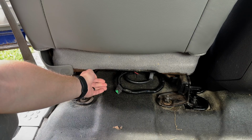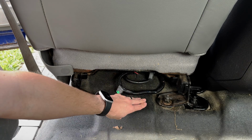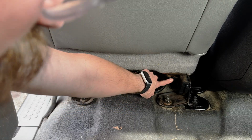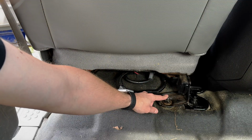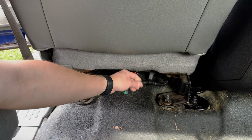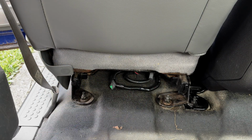So with the wiring all done, we also used some plastic wiring sleeve to protect it. And funnily enough, before we installed this, one of the wires got pinched between the seat mechanism and the stud on the truck and actually shorted out, and it blew the fuse, so everything worked properly. So we ended up having to cut the wire, re-splicing it in, and then with this on it, it shouldn't happen anymore. So that all looks really good.